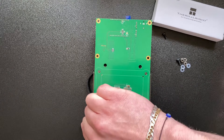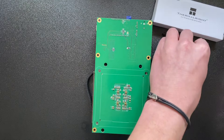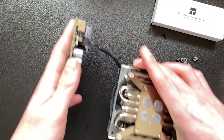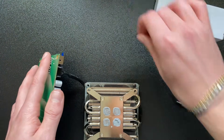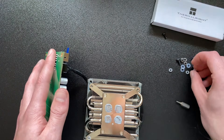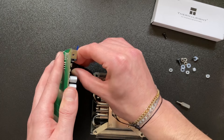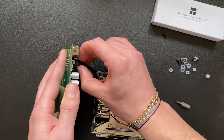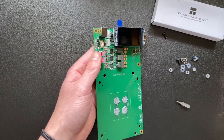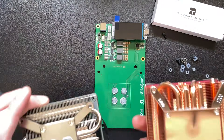You also want to give a little bit of space for the chips as well. Just the last one — be very careful because you don't want to damage the chips underneath. This is a very expensive piece of hardware. We don't want to get any thermal paste on the spaces. There's one there, one there, and two on here. We also need to unplug the fan — we forgot to do that. This is a lot cleaner than what we see for the Bitaxe in terms of the chips, but you can see it's basically the same architecture.